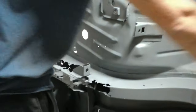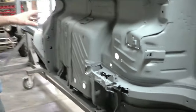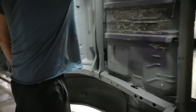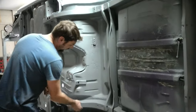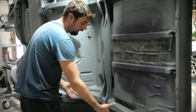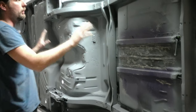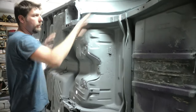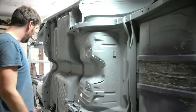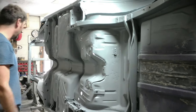This is going to be the first thing we're going to end up installing. We're going to try to keep everything in place, and when I build the frame jig, we're going to go off these mounts and these rear shackles, make sure they're mounted in. I'm going to build a couple of pieces as reference points so we can pull the frame rail out and slide in the new frame. I'm going to take measurements and make sure the car's previous work hasn't had these points moved — hopefully everything's going to be in factory locations.